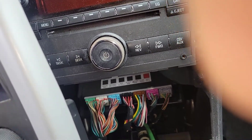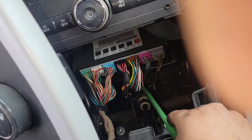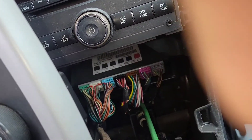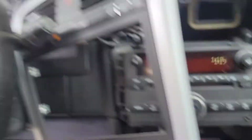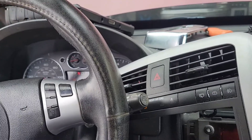We're looking for wire — I believe it's pin 22 out of the 25-pin connector, it's either 22 or 23. It's the pink and white wire, and it is the only pink and white wire in your brown connector. This is the wire the body control module uses to ground out the relay. The relay is built into the fuse box — there is no headlight relay that you can physically change. If the relay is bad, you have to change the entire fuse box.